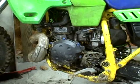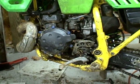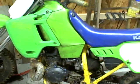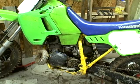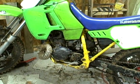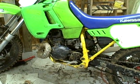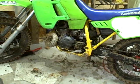It's a zero-pound flywheel — an aluminum disc off a chainsaw. The bike starts at high RPMs; you can't kick-start it, you have to bump-start it. But once it starts, by lowering compression and running always at full ignition advance, it blows out the charge at all RPMs with a lot of energy. The air that goes in gets hot and pushes itself out hard through the exhaust port, leaving a vacuum behind it, and then the intake ports uncover and the charge runs up.